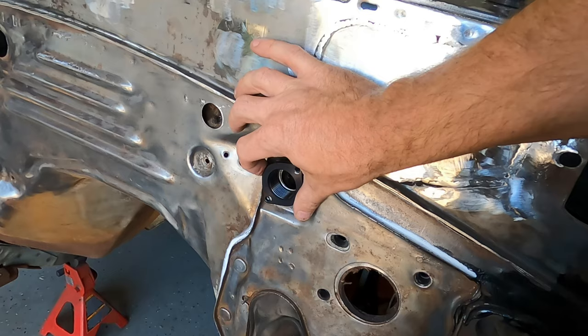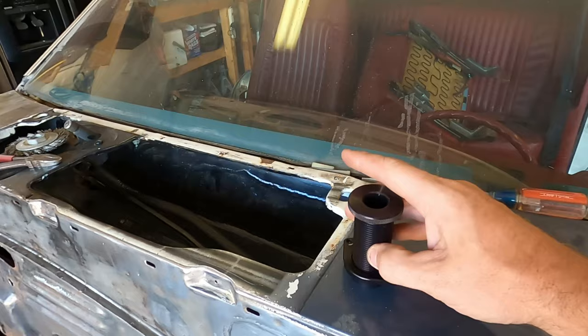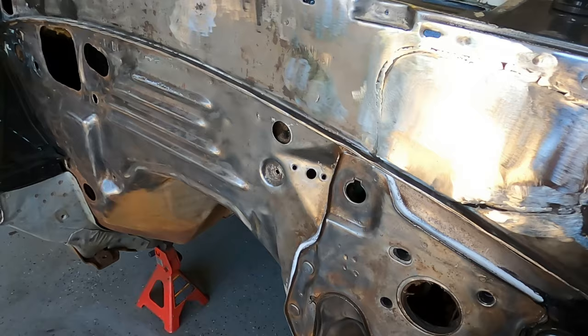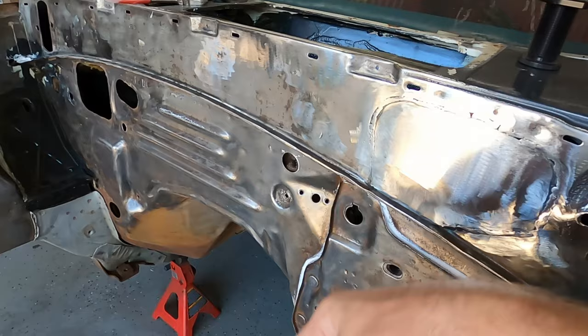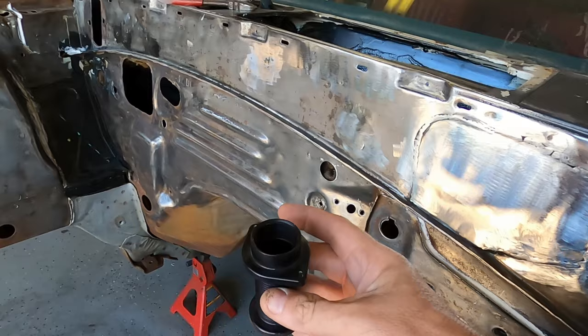However, as you guys know, this is a Maximum Motorsports clutch adjuster, right? It's the firewall adjuster. So we're going to be using this because I'm going to put a T5 in the car. But the clutch style that was on a 79 was just a simple cable, okay, that went straight off of the clutch pedal. It didn't have a quadrant. It wasn't self-adjusting. It was adjusted completely by the transmission end, and it used a different clutch cable completely. So we need to retrofit this area to fit a more modern style Mustang adapter. So we need to do that.